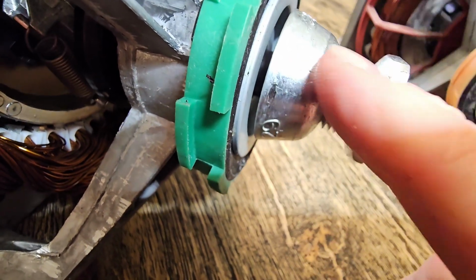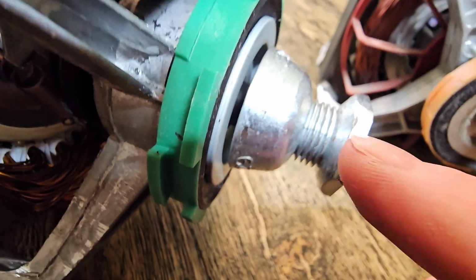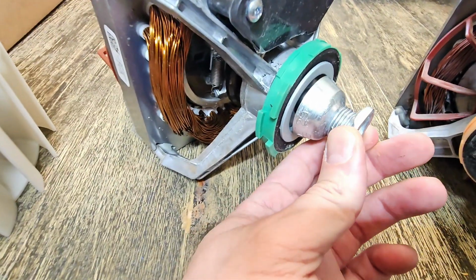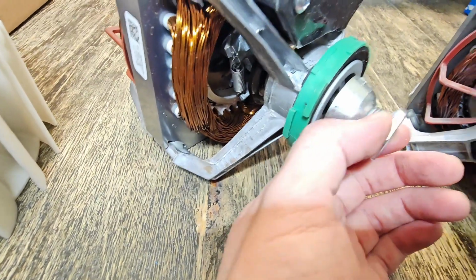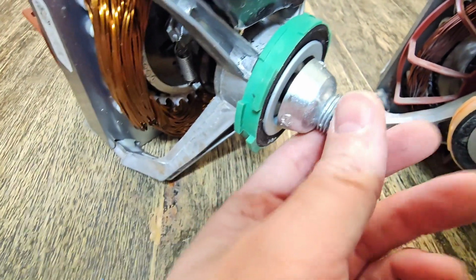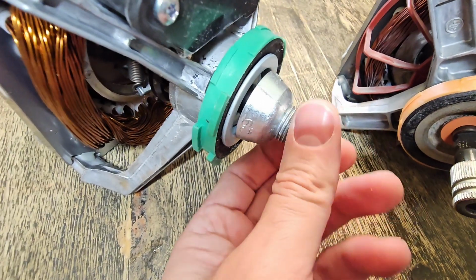Now, if your belts are getting shredded, they're getting shredded specifically because of this seam right here. So how do we solve for that? You get a piece of sandpaper and you fold it in half, or a really fine metal file, and you go right in between those channels and you smooth out that line. You've got to smooth it out. That's critical.